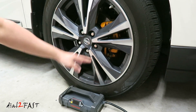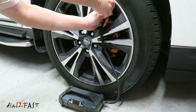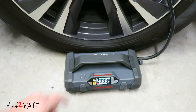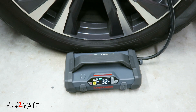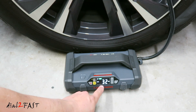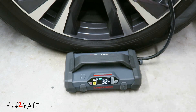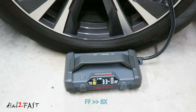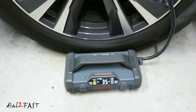Here I'll use the tire inflator to inflate my tire. Connect the hose to the tire and turn on the unit. Set the target PSI — it's set to 35 right now. After a second, it'll stop flashing and show you the actual measured PSI from the tire. Press and hold the pump button for three seconds to start inflation. Once it's properly inflated, the compressor will stop automatically.